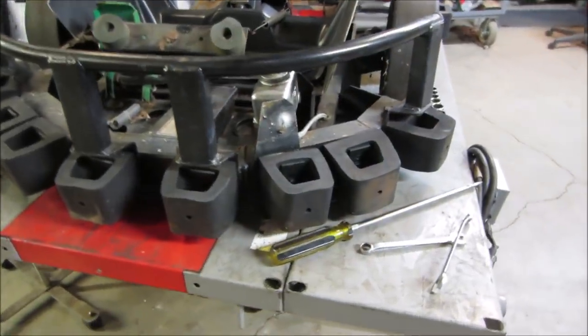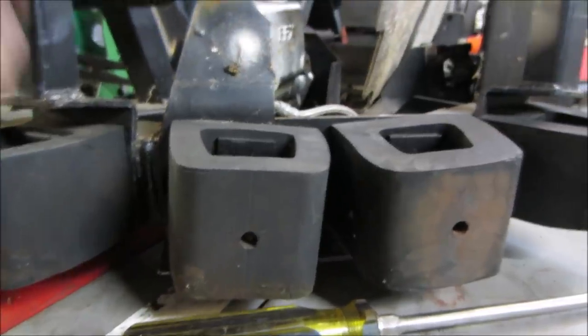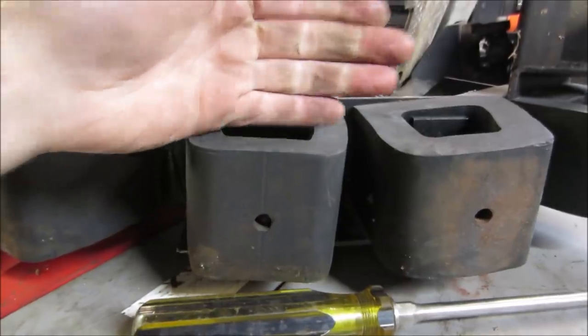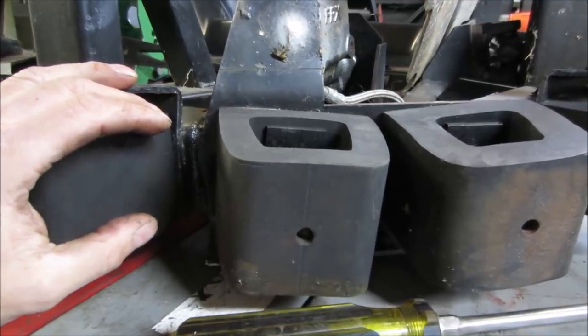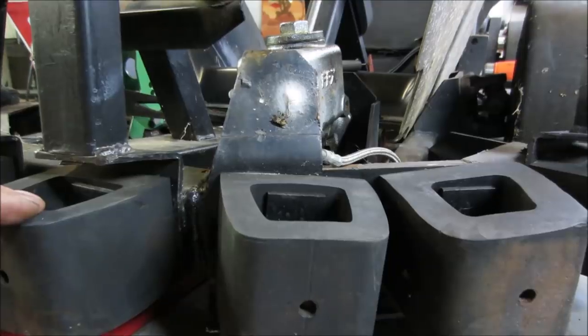I think I took the long way around on this one. Should just take another second and look at it a little bit. I thought this was welded on. It's not. It's bolted through these two rubber mounts. Takes that off and it looks like this whole plate comes out of the way. If I'd done that to begin with, I could have left the pedal alone, just unbolted the two bolts from it, pulled it straight out. But hindsight, you know how that works.